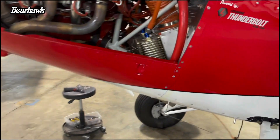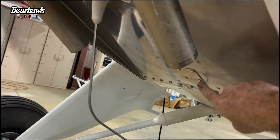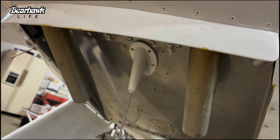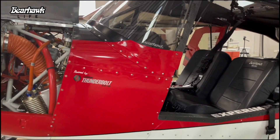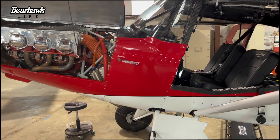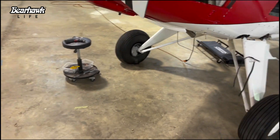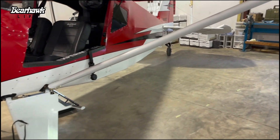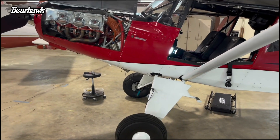The antenna was originally down at the bottom of the tunnel and I moved it up here. This seems to give it a better ground plane. I also moved the antenna cable, which had been running parallel with a GPS cable — that could have been creating interference. Now that the antenna is up at the top of the tunnel, we're getting loud and clear transmissions. I can actually pick up the ASOS in here in the hangar with the hangar doors closed, whereas before I could taxi right up within 200 feet of the ASOS antenna and still wasn't receiving anything. COM problem is solved.